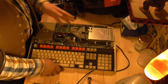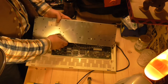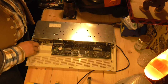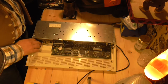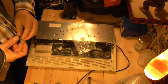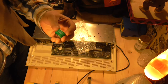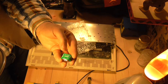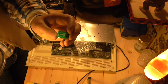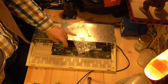I just want to get it up and running, booting off floppy. It does boot, but because the battery's dead it doesn't keep its settings. So I'm going to be replacing it. It does have, under here, a battery bay that was never actually used — so I could put AAA batteries in there if I found connectors and things. But I found a far simpler way that plenty of other people have done. This is a Varta Mempak 3/V150H — 3.6 volts, 150 milliamp nickel metal hydride. And it has lugs on it, ideal for just popping in place for this one, apparently.